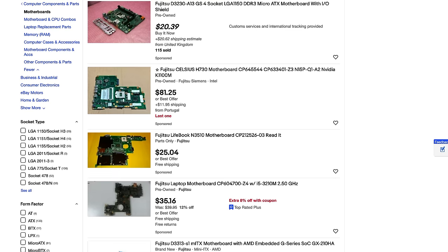In my case, the culprit was my 10G networking card, the Mellanox ConnectX-3. It's pretty old and I bought it for cheap, and because of its age, it doesn't really support proper PCIe power management. As a result, with the card installed, the system wouldn't go into deep idle. Unfortunately, the cheapest SFP+ card that supports ASPM is the Mellanox ConnectX-4, which starts at €170 on the used market — not really worth the investment. Another common culprit are cheap NVMe drives. Budget drive companies don't usually put a lot of money into firmware and power optimizations, so many of them won't give you proper ASPM support. I got two cheap SSDs — one from Sabrent and one from Crucial — and the Sabrent does not support ASPM and won't let my system go lower than C3. With the Mellanox card and the Sabrent SSD disconnected, the system now goes as low as C8, which results in 8W idle, even with four WD Red Pros connected in standby mode.